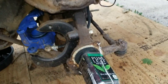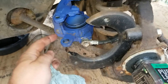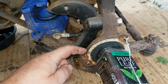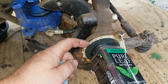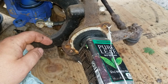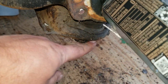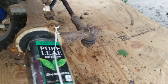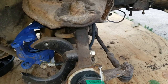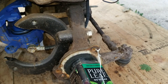Only doing what I can get done with the time and funds I've got. Got this side taken apart a little. Rain guard on the spindle here. We didn't take apart the brake line on this side and we're leaving it — there's a little paper gasket there so we're not touching that. Took off the dust shield, so we'll cut that down like the other side. We've got to pound this lip over a little bit. Steering boot is fine on this side. Basically all we have to do is get the shock out, which is going to be a challenge.